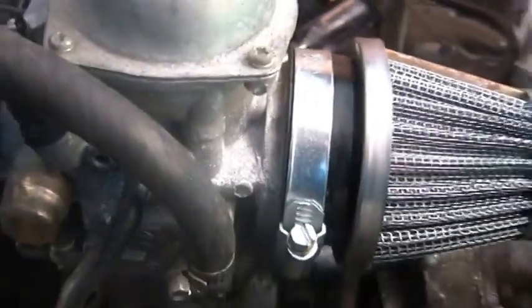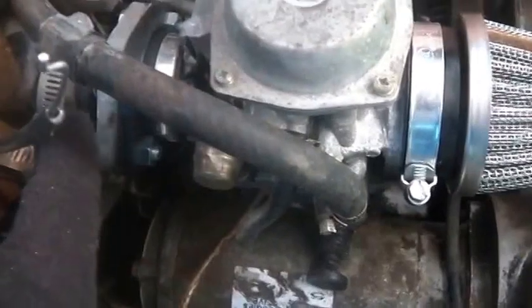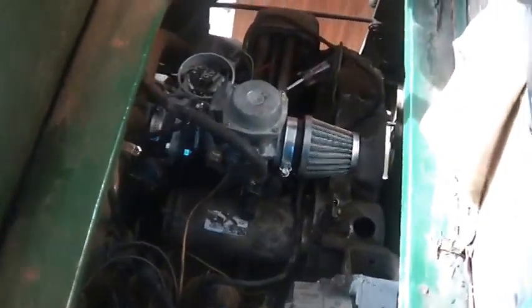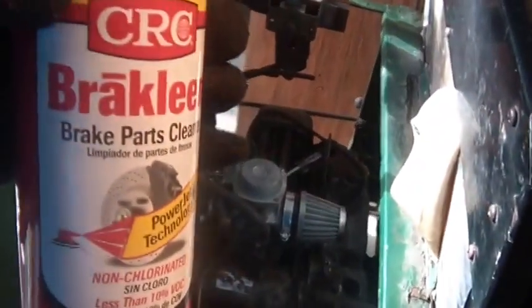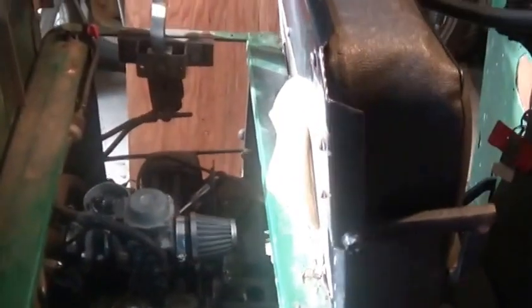Well, I had this thing apart when I first started it up and figured out what was wrong with it was the capacitor. I also went through the trouble of spraying all the joints on the intake manifold, and God knows there's enough of them, right? You got this one and this one, that one, those two, plus down on the two heads. So there's a million places for a vacuum leak. The way I do that is, once I get it running, I just spray it with a little starting fluid or brake clean, something with some volatiles in it, and the engine will change tone as it gets sucked in the vacuum leak. I did that too, just to make sure I didn't have anything else going on.